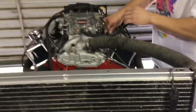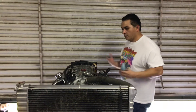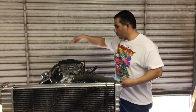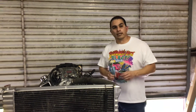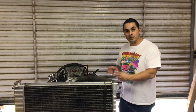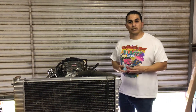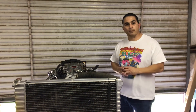Now we can rev it up so you can see — it doesn't shut off. And that's how you set your timing. It's very simple, very easy. You just move your distributor whichever way it needs to go to set your timing, adjust your idle mixtures, and that's it. If you have any questions or you want a closer look at something, let me know in the comments. You can also message me on Facebook at Ray's Engines. We'll see you on the next video — thanks for watching.